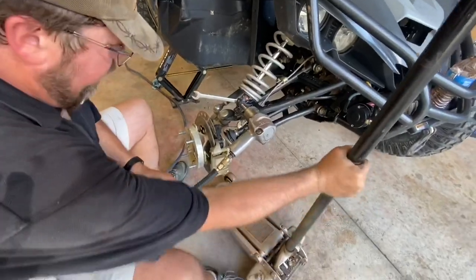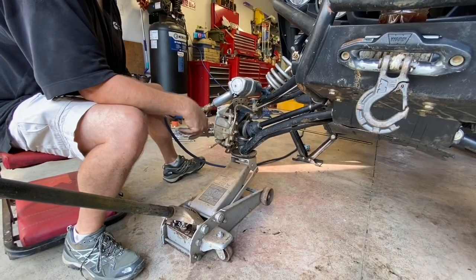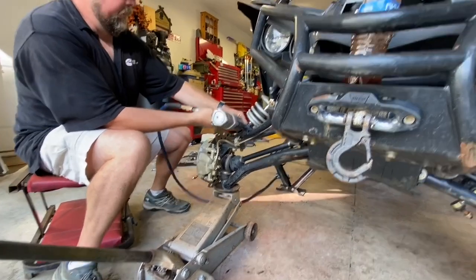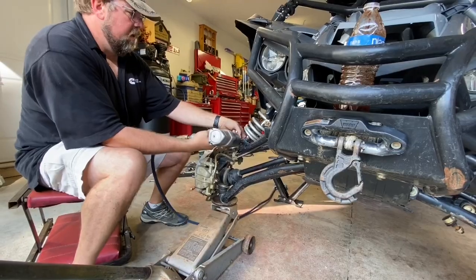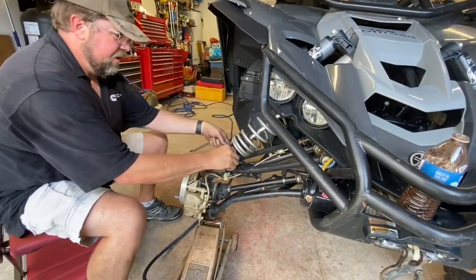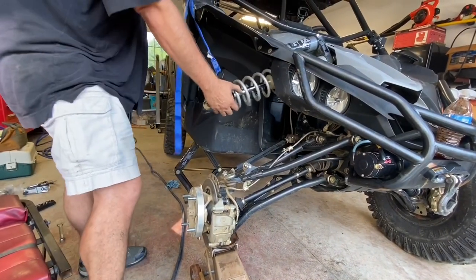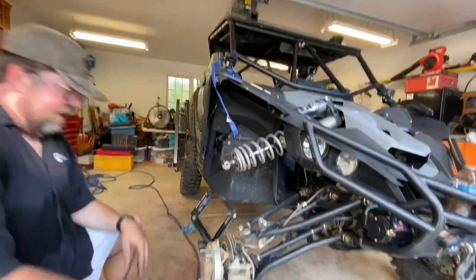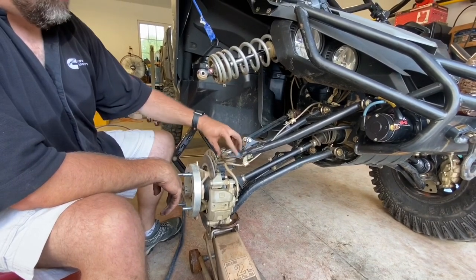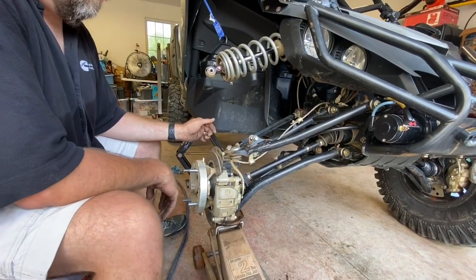The first thing we're going to do is support the lower control arm with a floor jack. We're going to pull this off, let it down a little bit to take some of the pressure off the shock, then tie it up just so we can get it up out of the way. You can see our shock is now loose. I'm just going to take one of these cheap ratchet straps and find a spot here on the body to keep it supported and up out of the way, not constantly backing up and hitting against it.